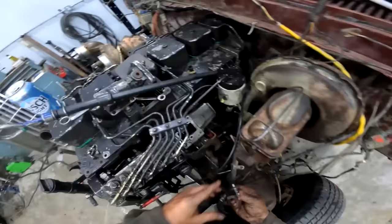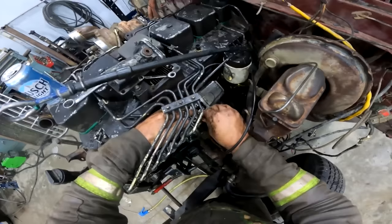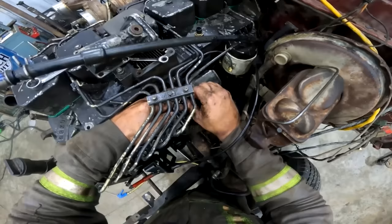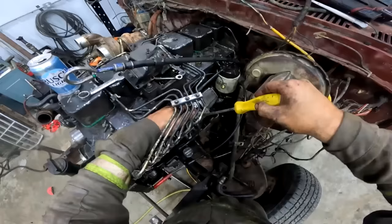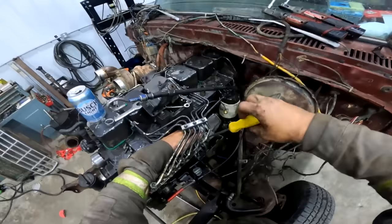And while she's still hot from grinding, just bolt her right back in there. Oh yeah, all the fuel. Now I think you slide this guy all the way to the front for maximum fuel, and then the AFC all the way to the front, and then we can dial that spring in on there so she just vomits black smoke, because that's what you're gonna want.